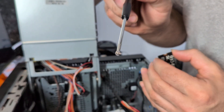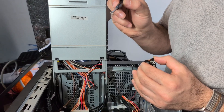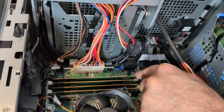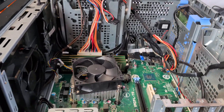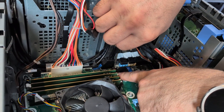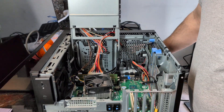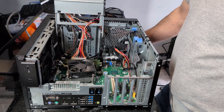We need to take this screw — and usually you don't have this screw, so buy yourself a set on AliExpress. It's about five bucks for 10 screws and standoffs, and it's an M2 screw, so you won't be able to buy it at Home Depot. Now we simply insert our storage drive like this and screw it down — just like that. You don't need to screw it down very tightly; it's good enough. At the moment I don't have any heatsinks — I'd love to have one because this drive gets pretty hot when moving a lot of data. We're using this drive as a backup for pictures, videos, and family archives.